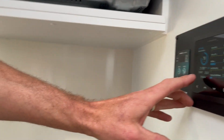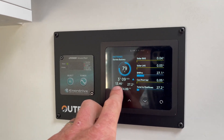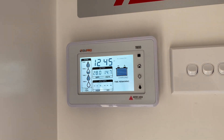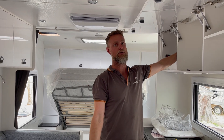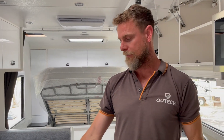Whereas a unit like this up here measures its voltage on the output terminals of the unit itself. It has to do that because it has no ability to measure voltage down at the battery unless there was a shunt. These systems do have shunts, but this system won't have a shunt, so it doesn't have that capability. Right now the battery is measuring 13.47 volts — you can see that on Symarine — whereas the Trek screen, the BM Pro, is showing 14.7 volts, which is 1.2 volts higher at the terminals of the BM Pro versus 13.46 down at the battery.